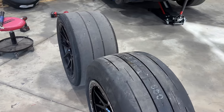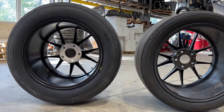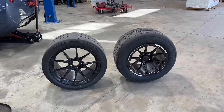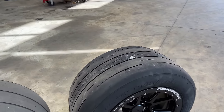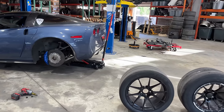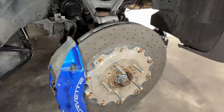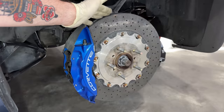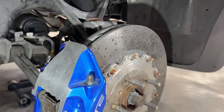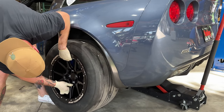Once we deflate this one to around 16 to 18 pounds, whatever we're going to be running, I think it's going to look a lot more like the contact patch of that one. Even though we're going from a 19-inch wheel down to a 17, we actually pick up height because of how tall the tire is. I don't know what that extra height is going to do to our trap speed, but this big soft sidewall is going to help us from blowing the tires off in first and second. We're out of going down on tire size — with a car making this kind of power it makes sense to go to a 15-inch tire, but we can't do that without giving up our carbon ceramics. The brakes are so big we couldn't even fit a 17 without sending our calipers out to get shaved down. So I'm hoping this is the perfect happy medium.